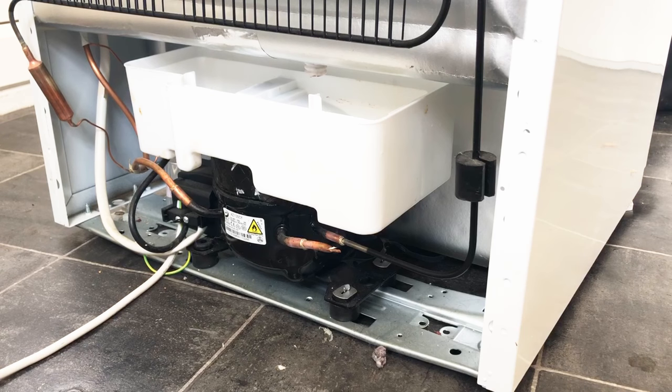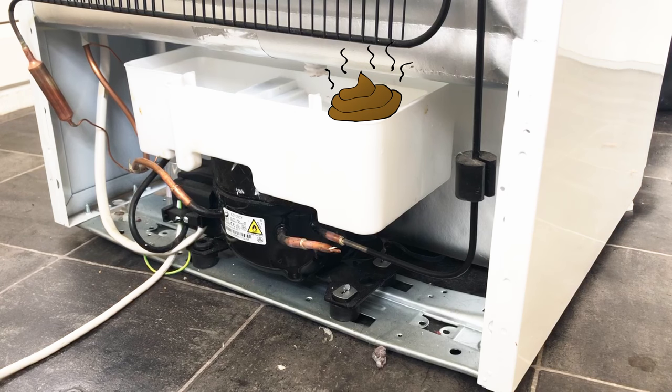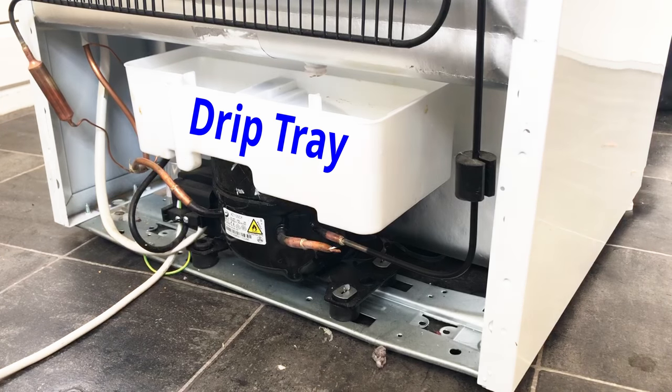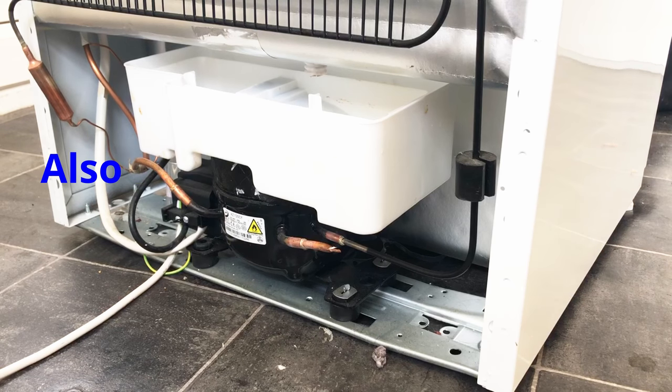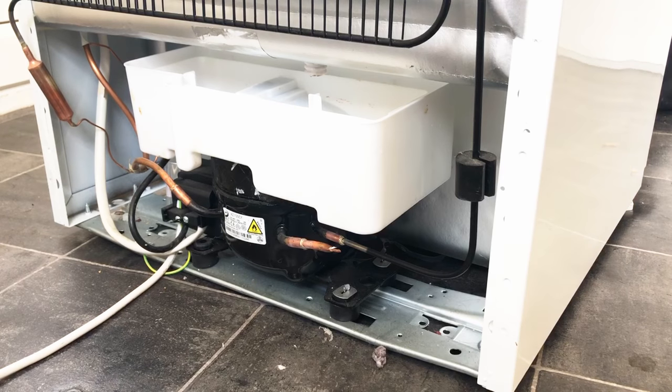I've had a look online and there's not much out there about this, and some people do really struggle to empty these. If you've ever noticed some strange smells in your kitchen around your fridge or freezer, around the back you've got what you call the drip trays, where all the condensation off the back of your fridge runs down and goes into this drip tray. The idea is that the heat from the compressor evaporates the moisture that goes in there. But because moisture can come out of the foods and whatever else you've got in your fridge — like spilt milk and stuff like that — when it drips down the back it can get mouldy, get flies in it, and it can become really nasty.